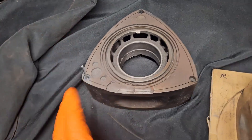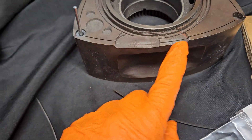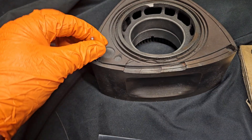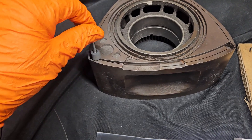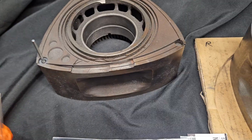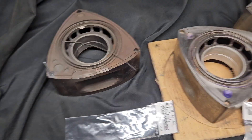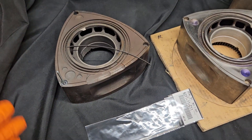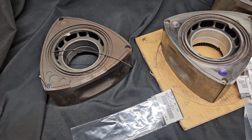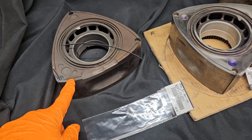The builder's goal with brand new side seals: get yourself a junk rotor, cut a little area out so you can drop your side seal in the groove, get yourself a drill press. We sell these little bits — they're on the KMR store and the eBay store. When you're cutting your side seals, you're able to not only create a nice square end, but it's also going to match the radius of the corner seal. That way you don't run into improper fitment, binding, loss of compression too soon, or components that wear out too fast. When you're looking for reliability, performance, and good builds, you want to make sure you're landing on the tight end of those Mazda specs and that everything fits and moves properly.